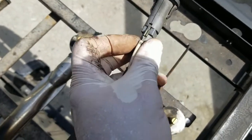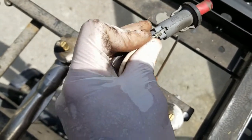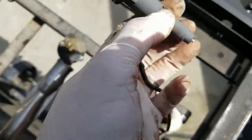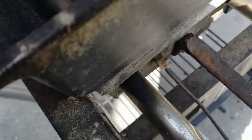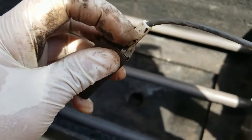On this end, just pull the white wire off — I've already done this with pliers, which just makes it easy. Pull that off and then do the same with this one — pull it off with the pliers. Now that the cable is disconnected from the button side, remove the white cable from this end and pull the igniter out inside the barbecue. Looking at the removed igniter, you can see the clip that was folded up that keeps it in place, and this is where the white wire connects.